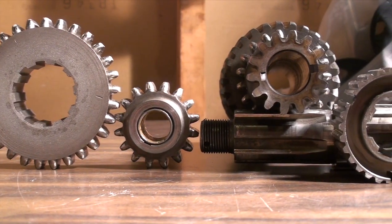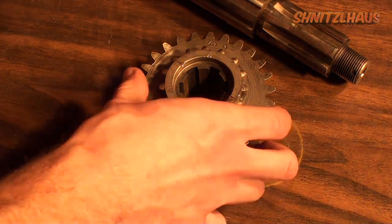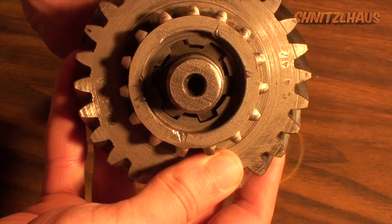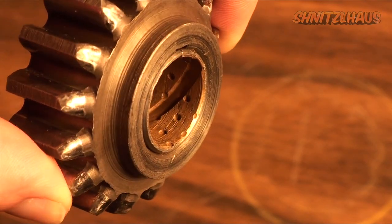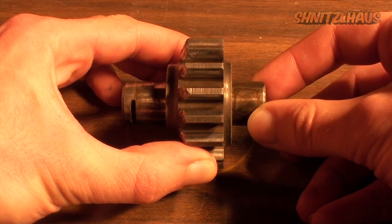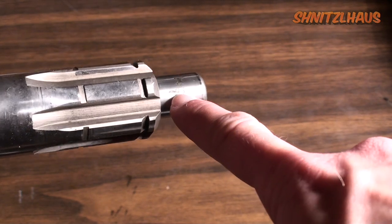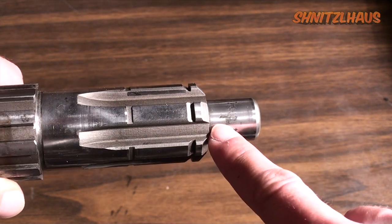You should look at and inspect the circular and splined bores of these gears. Inspecting the splined bores is simple — just slide your gear onto the main shaft and visually see if there's any play. My gear is a good example because it's heavily worn and you can see the main shaft can rotate a lot. For smooth bores with a bushing, visually check for abnormal wear or embedded material. You can also inspect the idler shaft for any uneven wear, or insert the shaft and see if you have any play up and down. Remember there is an oil clearance, so you don't want a real tight snug fit. Any surface that needle bearings ride on should be smooth and clear of pits. If you're not using your vehicle frequently this amount of wear may be insignificant, but if you're putting on a lot of miles you may want to opt for a new part.